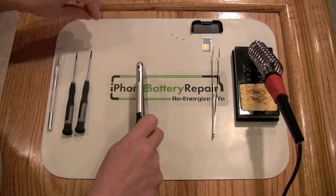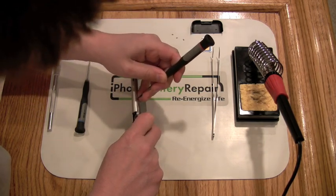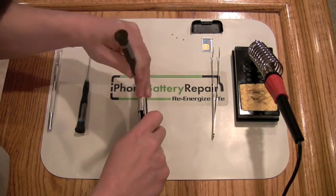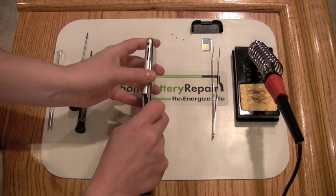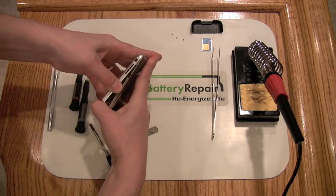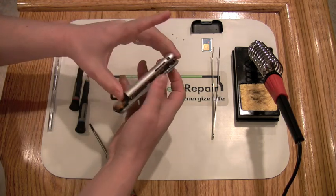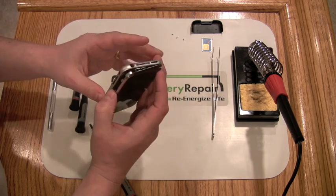Once you have a crease large enough on the side, leverage a tool into position and pull the side out. The cover should pop, providing a larger gap between the back case and the front of the iPhone. You should now be able to leverage the remaining case opening by using your hands.